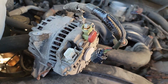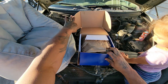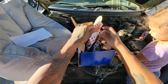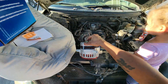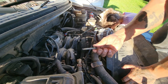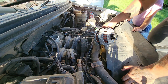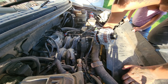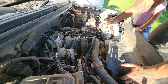This is a refurbished alternator. There's a core cost of $38 — if you return your old one, you get the $38 back, so that's a good deal. This is the new one compared to the old one. I'm going to slip the bottom alternator bolt back in because that doesn't really need to be all the way out. You can put some anti-seize on the bolts as you're putting them back in because it will be easier to get out next time, but I forgot mine at my shop.